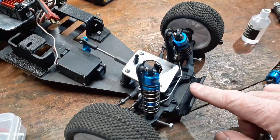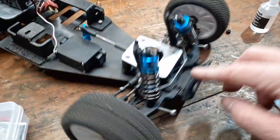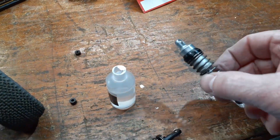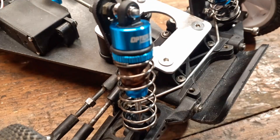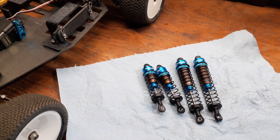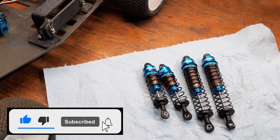They're sitting up a little higher than I want but they're the exact same height as the old ones, so it must just be the ride height Kyosho set for the car. It's really cold in the garage right now - I put 30-weight oil in them. I also replaced the o-rings; the little thin ones they came with are pretty weak. Decent little shock once you put some work into them. Thanks for tuning in - please like and subscribe, and these are going on the Ultima one day - hopefully I'll get that project finished up. Thanks guys.